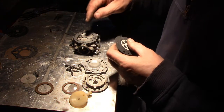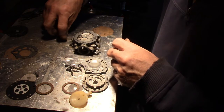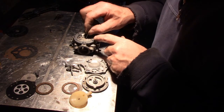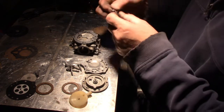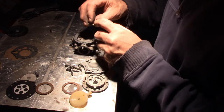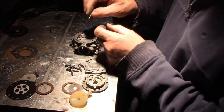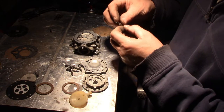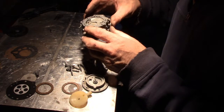You know, as far as you can bend this, pry this up a little bit, because when this goes up and down, it opens up the, you know, the needle. See how that goes? So when this thing is pumping, it's letting fuel in and out. And it's a good possibility that this was bent down too much. Like if you put this in there and it wasn't doing its job to let the fuel in, so that's a good possibility. We had to take it apart anyway, so you might as well put the new gaskets in. But you would just bend this tab up just a little bit, like that. That bent up kind of really easy. And then install it back in so it'll push down, so it'll lift up that needle. That's probably what was wrong with this, because it's very clean.